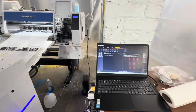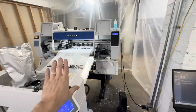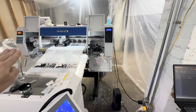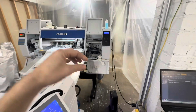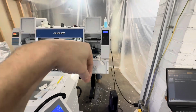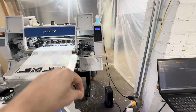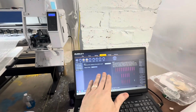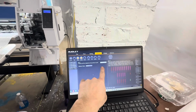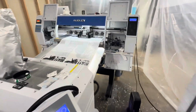And lastly, if you are noticing that your prints in certain spots are looking slightly blurry, what is happening there is that each time the pendulum swings back and forth like this, the dot that the printer head is putting down is landing in a slightly different place, maybe 0.5 millimeter to the left or 0.5 millimeter high. You can adjust that here. That will look like a blurry print. Run the bidirectional adjustment and you can salvage that.